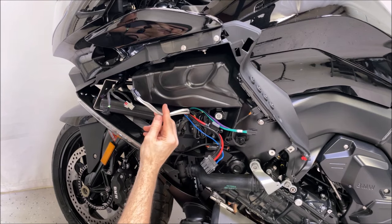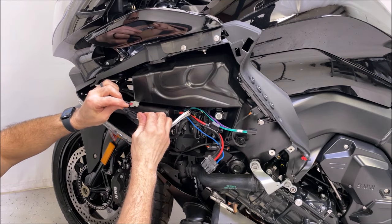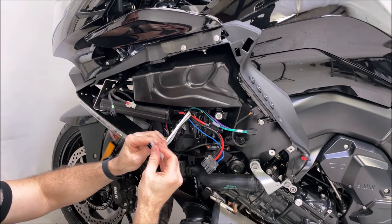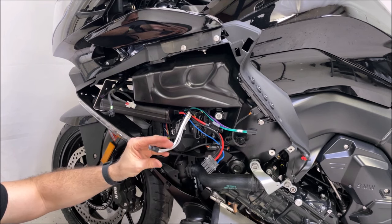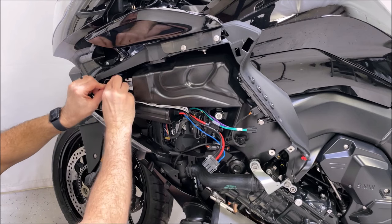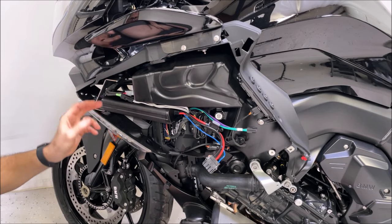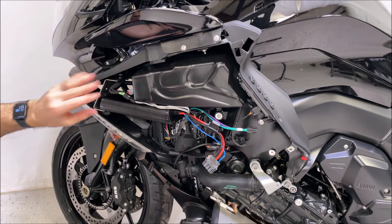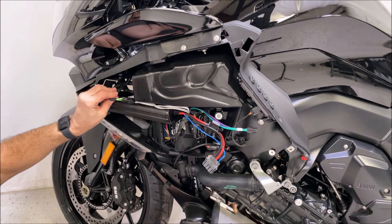This is the front output of the amplifier — the white and gray wires in the bundle — which plug to the same black plug here and feed back to the new speakers. Same thing: put a little dielectric grease in here, plug them together, tuck them right up in this hole, and wire tie to this bracket. There's an extra hole in the top of the bracket for a wire tie. You may want to wait until you've done your speakers up top to make sure you have enough slack before tying these down.